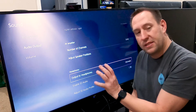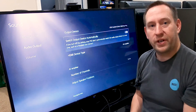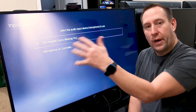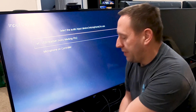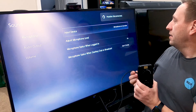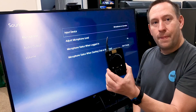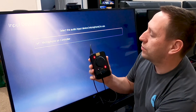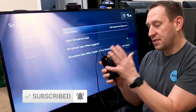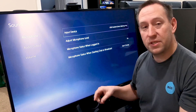Once those connections are good, I can plug this in. Now I want to go to the sound settings, go to audio output, and set it to chat audio — because I want only the chat sound to go through the USB, with the rest handled by the full sound setup. When I plug this in, I should see it say Astro Mix Amp Pro. If I do not see Astro Mix Amp Pro, I need to back up to the USB-only setting. Even with the optical disconnected, it still recognizes the Astro Mix Amp Pro. If I unplug the USB, it disappears and says microphone on controller. If it says microphone on controller when your USB is plugged in, something's not right — the USB must say Astro USB or Astro Mix Amp.